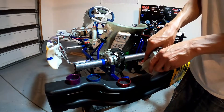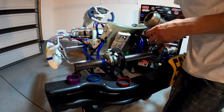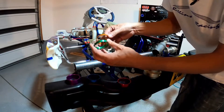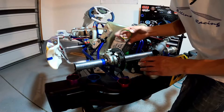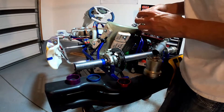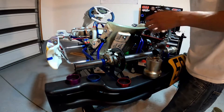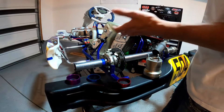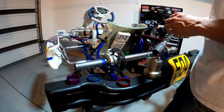With the harder compound tires we've been running and without a lot of carts on our track this year, I've chosen to go with a 7mm spacer and a 5mm spacer. That's putting me at 8mm narrower on each side than my full rear track width, simply because we're running a harder compound tire and we don't have a lot of carts laying down rubber. I've done that to give us a little help lifting that rear inside tire when cornering.